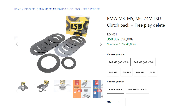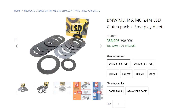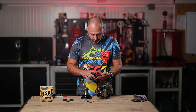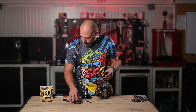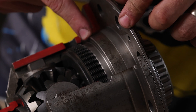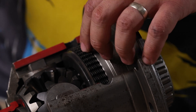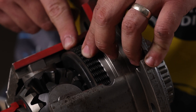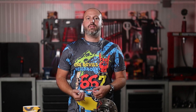The same philosophy is applied to the clutch stack. This is our clutch stack — outer plates and inner plates coated with molybdenum ceramic coating, as in everything we do in our technology. You also have a big preload Belleville washer that you place in the middle between the visco pump and the clutch stack. This is how we eliminated the free play and the delay you can feel on the track, completely.